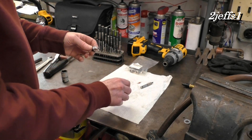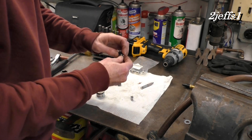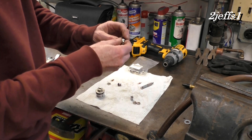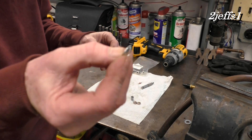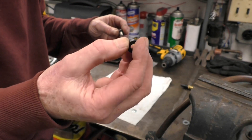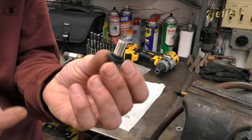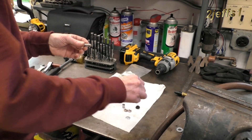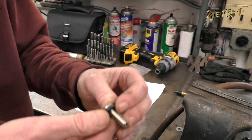Grab one of your replacement items — they come with a nice little cap. Take the double nuts off; these have two nuts on them. They've got a washer here which will help squish the seal, but this is optional from what I've heard. Take the totally flat rubber washer off. One side has a shoulder on it — you can see right here — you don't want that. So set aside the parts you're not going to use, then just put the one rubber washer on like so.